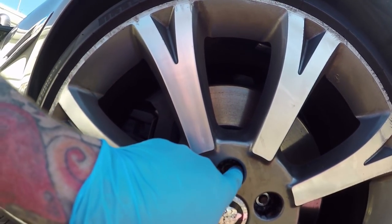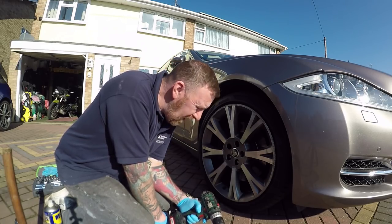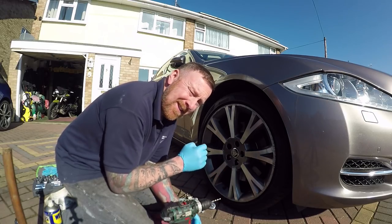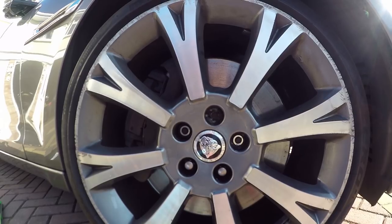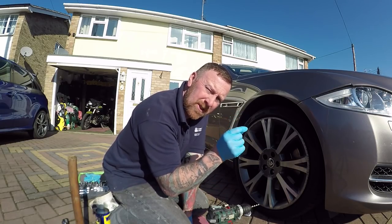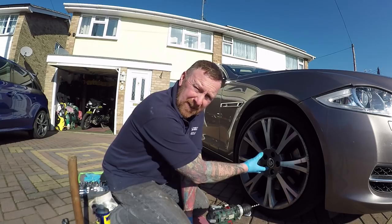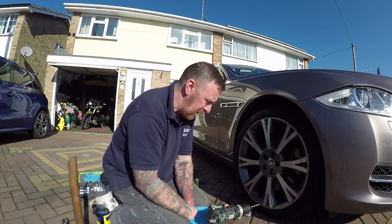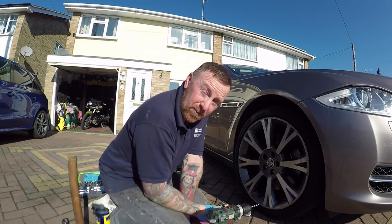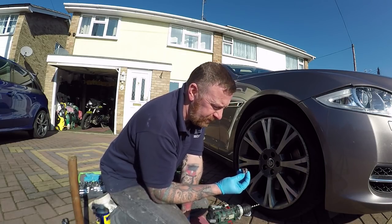This one I'm going to go a bit more shallow. I'm going to do that corner there. Really fed up, if I'm honest with you. I think I was lucky with the other one — I just managed to get some shape to it and get the socket on top. This one has absolutely just gone to bollocks. So what am I doing now? I'm going to drill smaller pilot holes around what's left, then bigger holes. They're going to do exactly the same to the other two. Then jack the car up, take the whole bloody wheel off. The inner part will be hanging on for dear life — I'll then get some mole grips and get them off. And then job done. What a bugger. I knew it was going to be hard, but not this much of a bitch.